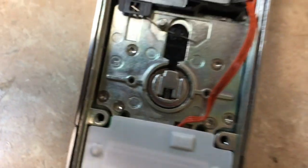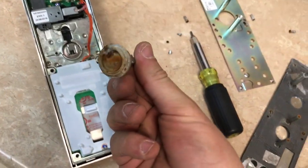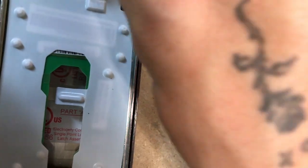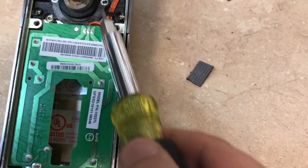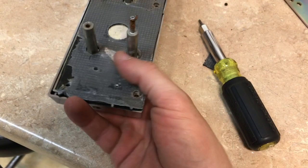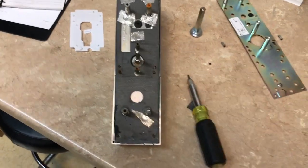Brand new one — there's your tiny little spring. Don't want to lose any of this stuff, so be very careful not to disrupt it. Old clutch — go ahead and pop that with some lithium. Now obviously you see the little hole right there, pop that right on just like that. I'm gonna go ahead and use the cover for my other newer clutch — still has this new water gasket and stuff on there. Got our screws back in, got the pre-existing clutch in, screws rewrapped, the cord rewrapped. Now we got our old back — go like that — and we'll just pop our screws back in and pop our handle on. Then we'll take it downstairs and try to hook it up and see if it works.